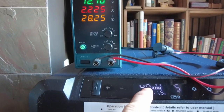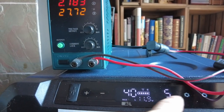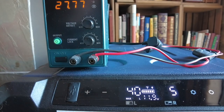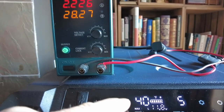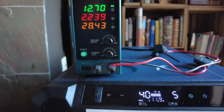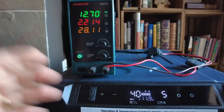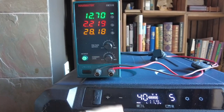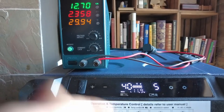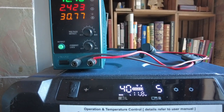The other thing you can't fully trust is the temperature readings. These show actual temperatures, not the set temperatures. Right now my freezer shows 5°F and my fridge shows 40°F, though I have it set to 37°F. The issue is that over the course of a day this will fluctuate — you'll see it go down to 35 and as high as 42 or 43. That's just the nature of these fridges. When you test the actual interior temperature, it's usually a little warmer than what the display shows, because the sensor is inside the wall of the refrigerator, not inside the refrigerator itself. It will still freeze ice cubes and keep your food cold — and really, that's what you want a fridge for. One other thing: it's dark blue, which may not be great in hot sun, so keep it somewhere shady.